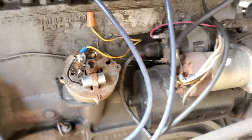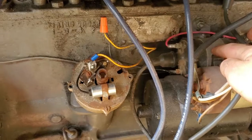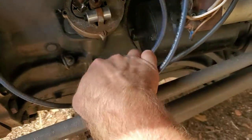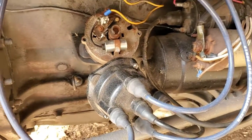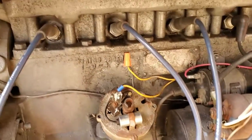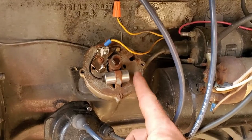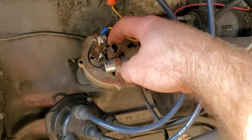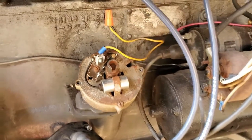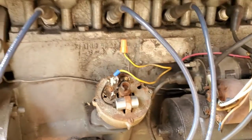Here's just a basic overview of how the whole system works. You have an ignition coil right here — 12 volts comes in and you have a secondary coil with higher voltage. When the points open up there's a break in current, and that discharges down to your distributor cap through the center wire. Your rotor, which sits right here, spins around and connects with your spark plug wires, distributing the current to your spark plugs to provide spark. The condenser absorbs some of the energy so that your points last longer — without it, your points would wear out very quickly. Overall, this system is responsible for transferring mechanical timing alongside electrical timing to your spark plugs so that they stay in sync.